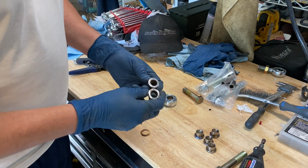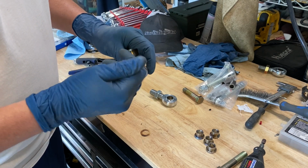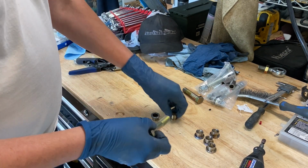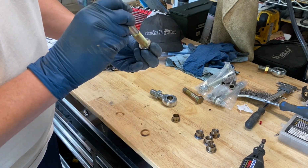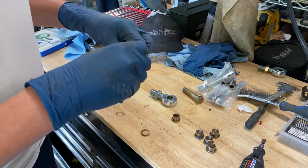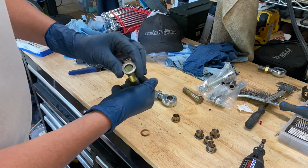Alright, so here we are with those last 2. Just used the grinder and another grinder to get this ring all cleaned up, and then as you see, as I try to get it on, well, we're still a ways off. Some of it is the grime, some of it is it probably being oblong from it being squeezed in the vise. So first I'm going to try to make sure that I get it round. So if we go through here, it looks like we're oblong a little bit. So I'll go get that clamped first.